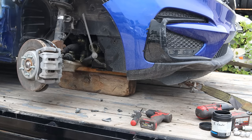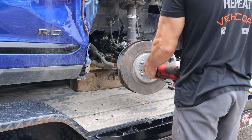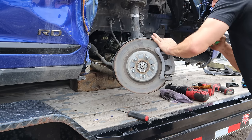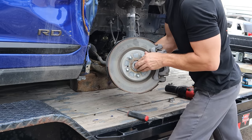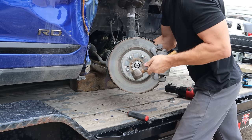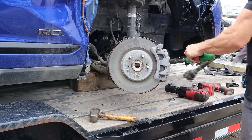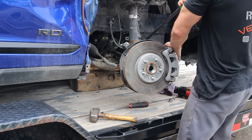We got some headlight parts. I want to save that one because that's the bolt for the bracket for the bumper. And it's more headlight parts. Pull our drive axle nut off of here and pull our suspension over. It ripped the ball joint out, so I'm just going to try to get the drive axle out so we can see everything in there and see what we're going to need. The control arm looks like a pretzel.